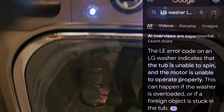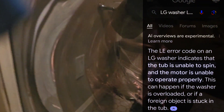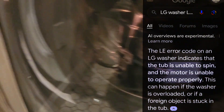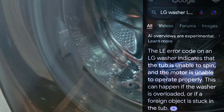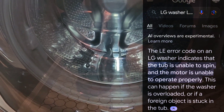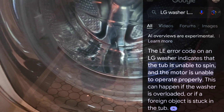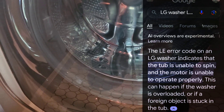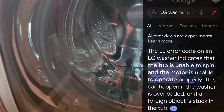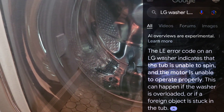The drum's been verified — there should be rotation. The drum should rotate, but what it's doing is oscillating because of the position switch — just going back and forth. This gives the indication that you're getting power to ground on both sides of the winding, or the position switch is not recognizing position. This is called a Hall sensor switch.